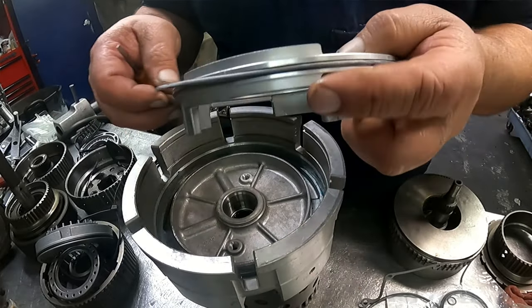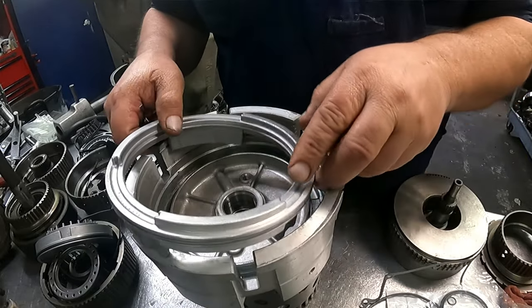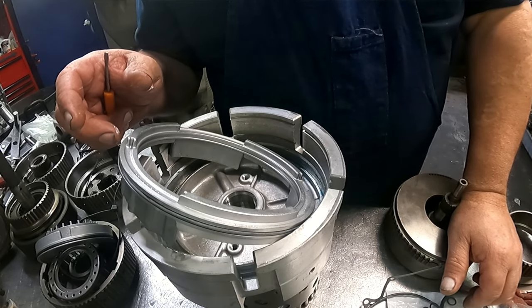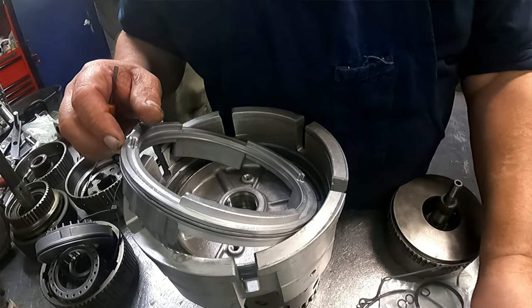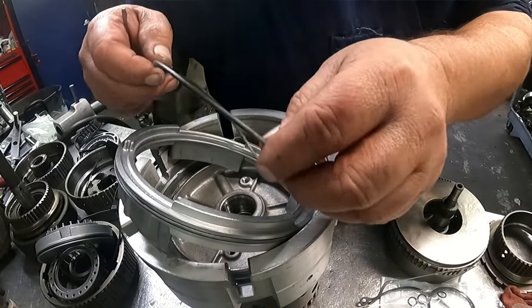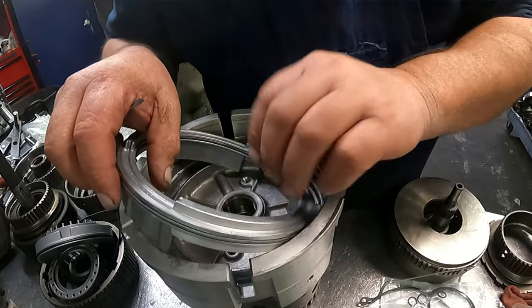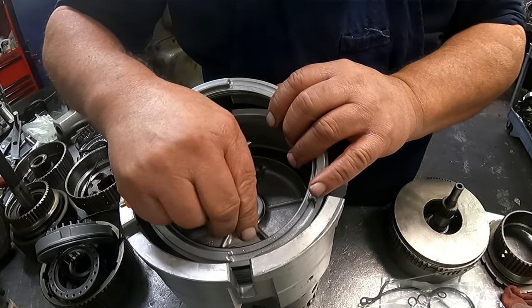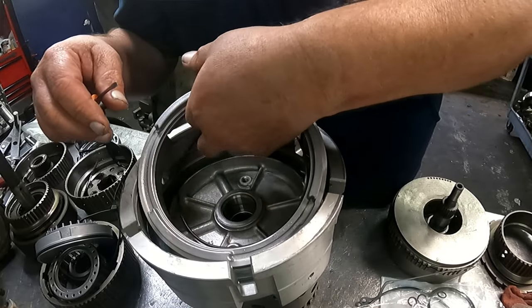The reason I know that they bought a junkyard unit is that there's two brackets that go from the transmission up to the block. The bolt holes for those brackets are not in the engine. So they didn't rebuild it, because those bolt holes would still be there. And they are not. Okay, see how that's a little small? You can take this O-ring and stretch it out.